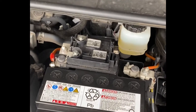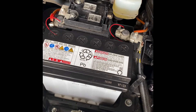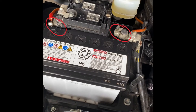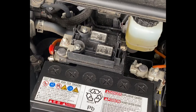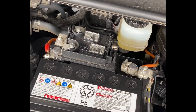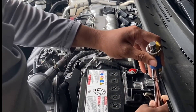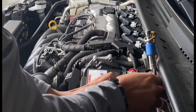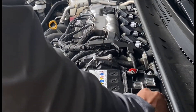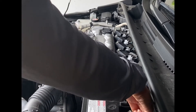Now that you've checked your battery's fluid level and noticed they're too low, let's go ahead and hop in. We're gonna remove the two bolts that you see circled in this video. Remember: righty-tighty, lefty-loosey. Make sure when you take off your bolts you put them in a safe place. Using a 10 millimeter socket, go ahead and start removing those bolts.